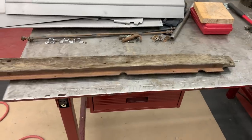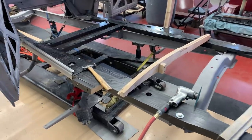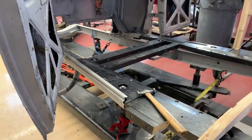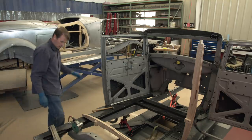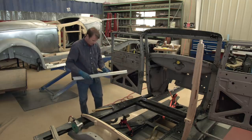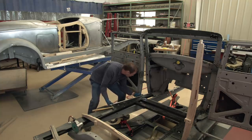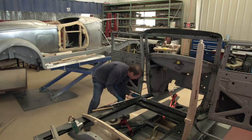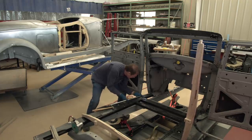This is the piece that goes up by the front floorboard — it's a cross sill. Thank God I had that piece. Where I started with all this is I had the original sill plates. I put those in there, and I trimmed my new ones to fit, and I thought that'd be a good place to start with the B pillar and fitting everything up. So once I had the cowl all mounted down to the subrails, I came along and put the door sill on there just so that everything fits. And I've got to have these door sills on there before I mount the body on the frame, otherwise you can't get to the bottom side to tack up the nails in the bottom. But once I got this all fit, looking good — and actually they fit really good.